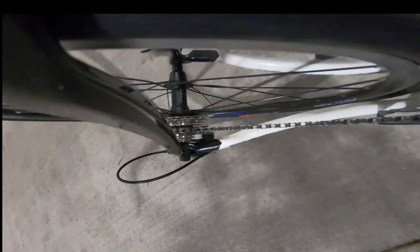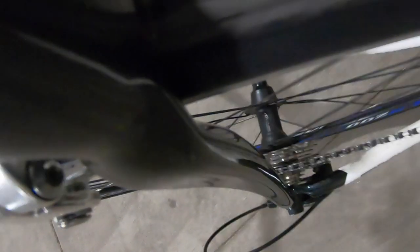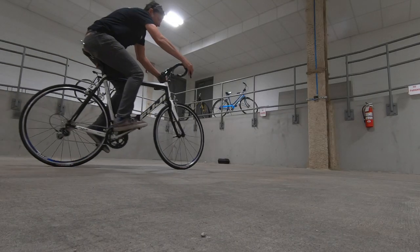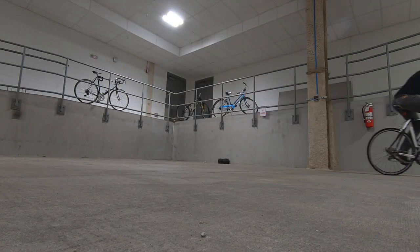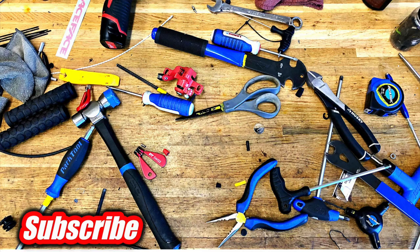What I like to do is put the new chain on, go out and hold the brakes on, and just pedal. You're having to really apply a lot of power to keep the bike moving — that's a pretty good, low-speed, safe way to check if it's going to slip. Obviously this one is slipping from maybe the middle gear and the next couple of gears, so that confirms it needs a new cassette.